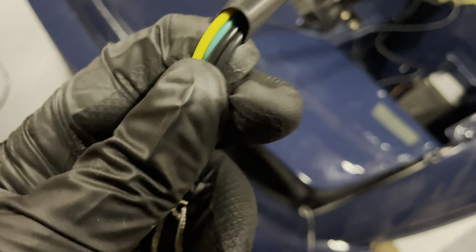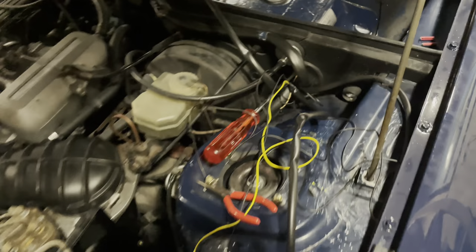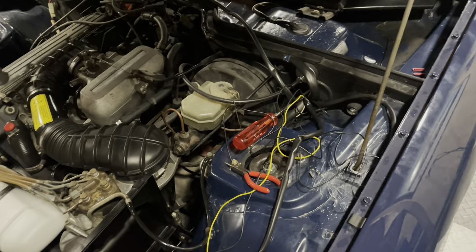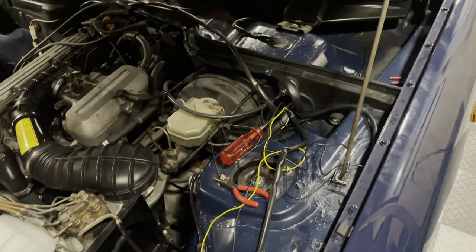So the yellow goes for the spots, the green is for the fogs, and the two blacks are the power wires — coming back individually for the fogs and the spots. I've now pulled them through the sheath, and that is going to join close to the firewall, making it nice and tidy so you won't see the cables. You can see it has the ability to run down there looking all nice, factory, and tidy. I've also redone the one from the battery — that's also running in a sheath, so it now looks like it's OEM. My next job is to push the yellow and the other black cable through the firewall so all the wire is roughly where it needs to be, then just hook up the switch and the relay and we can start testing.